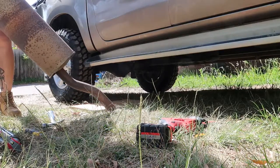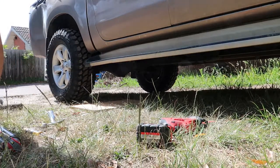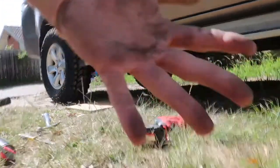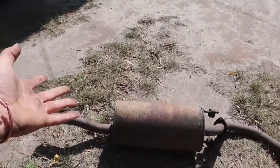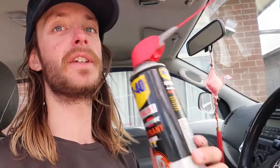Check that out — that's what was holding back everything. Check out how dirty my hands are. That thing has over 300,000 K's on it. A good way to get your exhaust hangers off is by spraying them with WD-40 before you do it — front and back — then you just yank it a couple of times and give it a smash with a hammer if needed. They'll just pop off. It's good to have someone help you so it doesn't just drop straight on your head.